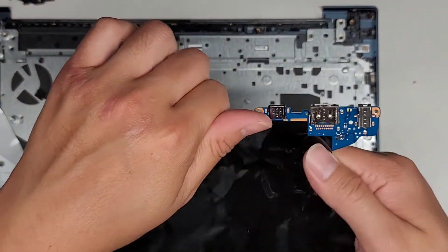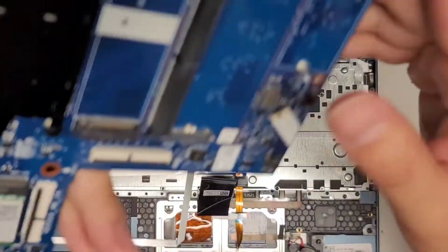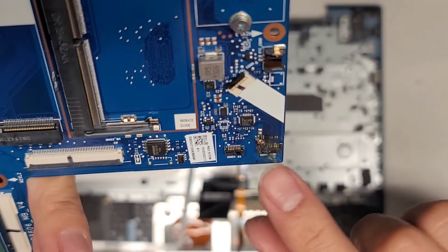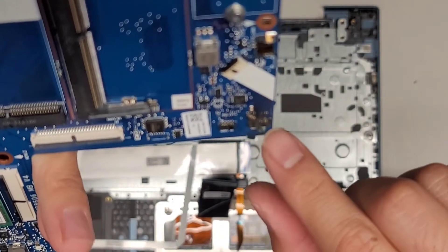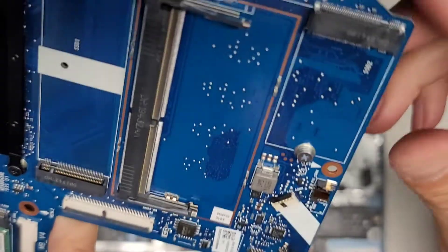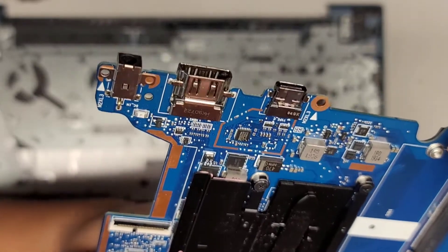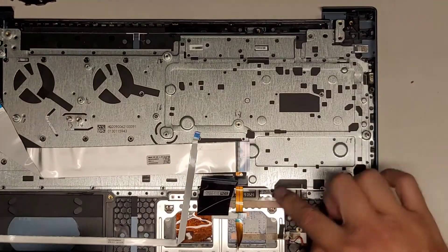We didn't fully check this side so let's rotate it and continue peeling from this side. Peeling from the sharp points to try and avoid tearing it again. It looks good, so we're going to just tape that back down. Corrosion-wise it looks fine on the back — the worst thing I see here is this hard drive connector. I'm going to use some warm water and a toothbrush to scrub this up a bit, then some rubbing alcohol.